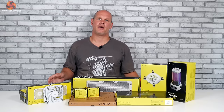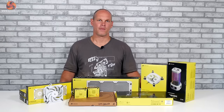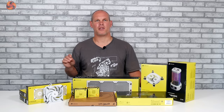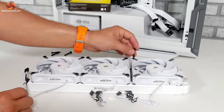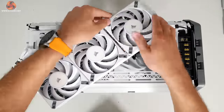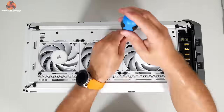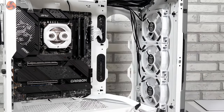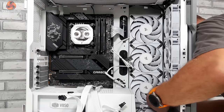The next job is to get all the radiators and fans fitted. Before installing a new radiator it's a good idea to give it a flush using distilled water — this helps swill out any manufacturing debris that could cause a blockage later on. When installing fans, take note of the orientation of the radiator relative to where your fan cables are, to keep everything neat. Our top radiator draws in fresh air so fans sit on top in a push configuration. The side mounted radiator will push hot air out the side of the case, with fitting ports to the bottom.